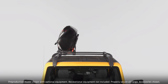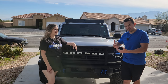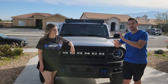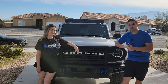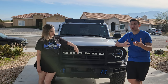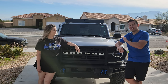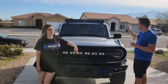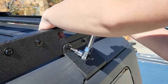But if you have a lightweight rooftop tent, you can get to camp and hop up in there no problem, because that's where the static weight limit comes into play — and that's 450 pounds. So you can definitely load the roof a little bit more when you're not moving. When shopping for a roof rack, check the manufacturer's description to see what their weight limit is. It generally can't go much higher than Ford's recommendation unless it's mounted differently than the stock locations, which were in the front of the Bronco and on the hardtop itself.